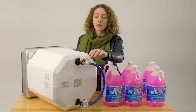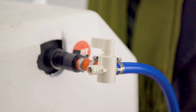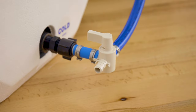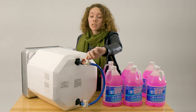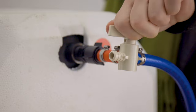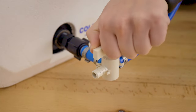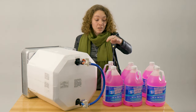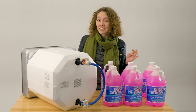Basically, if you turn this lever towards the hot water heater on both sides, the cold water comes in and goes to the hot water heater and comes out just like it normally would. But if you switch it so that it is in line with this tube right here, then when you are winterizing your RV the antifreeze goes straight past the water heater — doesn't even touch it — so you don't use six gallons of antifreeze when winterizing your system.